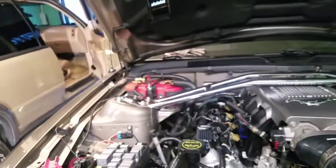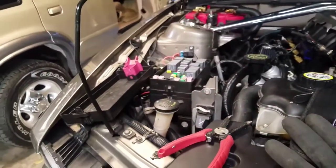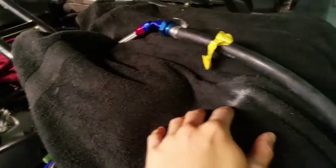I went over and looked at the grounds for the pump in the back — they look good. I'm actually getting ready to try some new relays just to be on the safe side, but I don't really think that's the problem. What I did is I pulled the fuel line off with the hose attached, had a bucket under here, and primed it — no fuel came out.